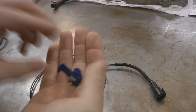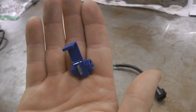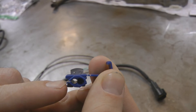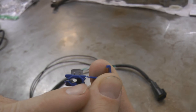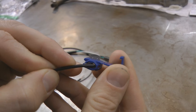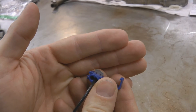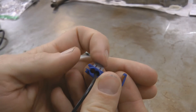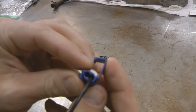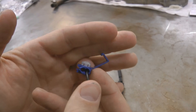I'm going to show you how to do it the quick and dirty way with one of these inline splicers — I don't really recommend doing it this way, so do as I say and not as I do. These things have two holes for wire. The outer hole is for the selector switch wire to pass through. The inner hole is where we slip our splice wire in all the way until it stops. Slip this little splice connector over the wire on the selector switch, then take some pliers and clamp down on this metal piece — that slices through both wires and makes the connection. It's got a handy little piece that folds over. We'll do that for both the green and the black wire.